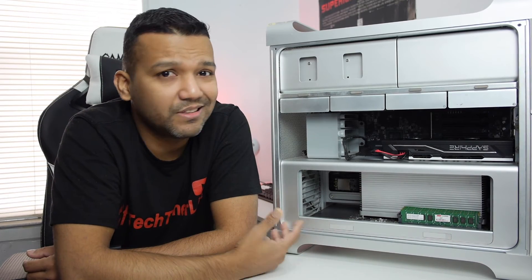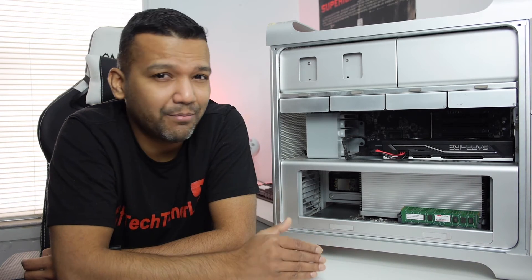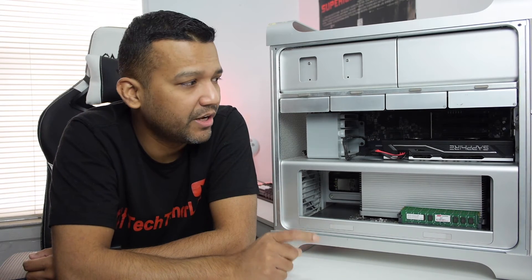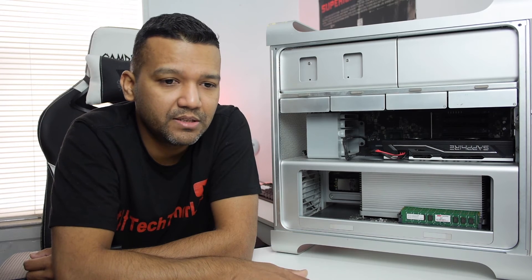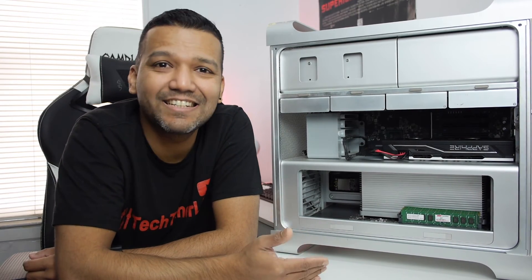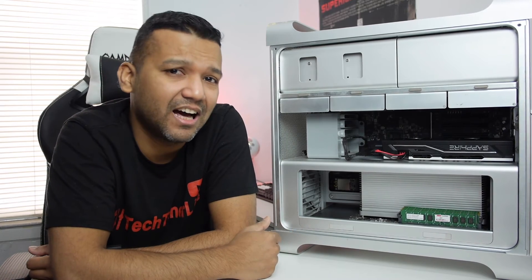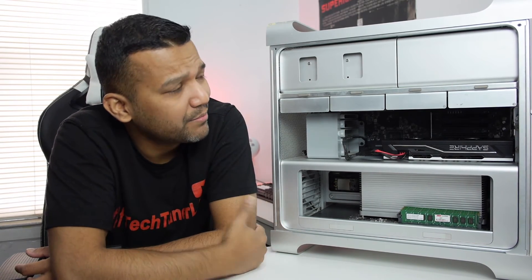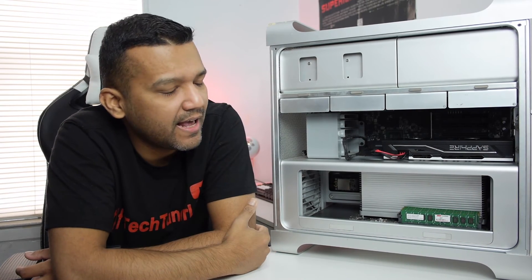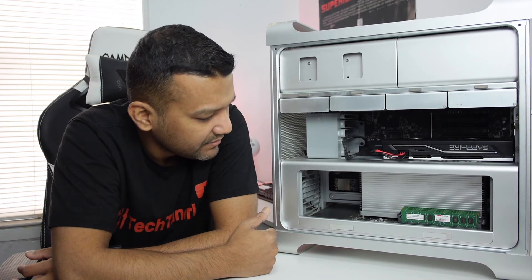If you're on a budget right now, you can pick up a 2009 Mac Pro and update the firmware to Mac Pro 5,1. You can add an SSD, a newer graphics card, and most 2009 and 2010 Mac Pros come with a quad-core CPU that's easy to upgrade to a six-core. If you don't want to spend much, the Xeon X5650 is around $18 and is still a six-core, just with lower clock speed. Pair it with 16GB of RAM and this Mac Pro is really good.